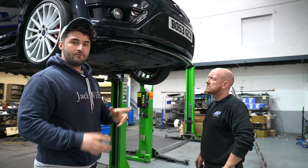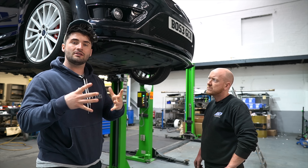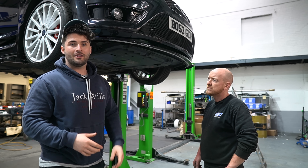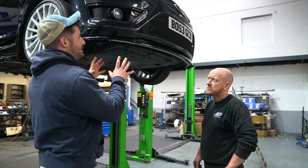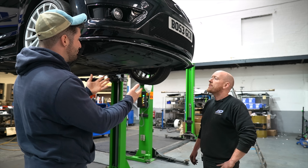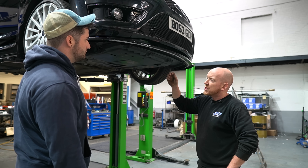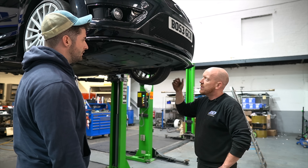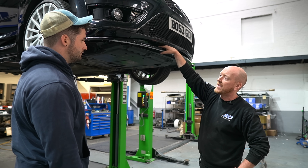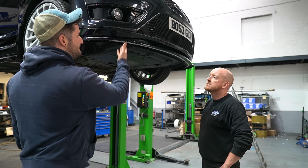The kit provided screws do work, but we suggest using screws just a little bit bigger — that way it'll hold. I want reliability and prolonged efficiency when it comes to the kit on my Focus ST. Ben agrees: the rubber mounts are rubberised and the small screws were pulling through, meaning they probably wouldn't last. Also, when going onto something like a splitter, be careful your screw doesn't come out the other side — especially on a brand new splitter we only installed today.